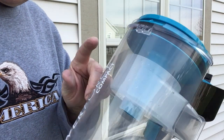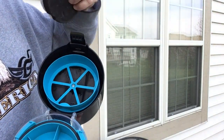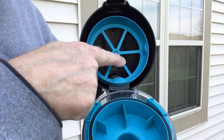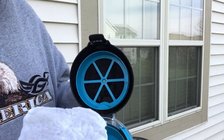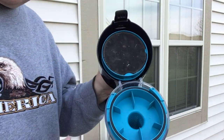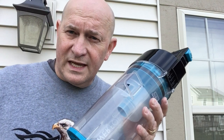Mine's still a little wet — you can see some watermarks because I did clean it all out. When you clean out the filter again, the filter has a little notch on it and you'll see two notches to accommodate it — one big one and one smaller one — so you can make sure it's going in the right way, meaning the paper side is toward the suction going toward the motor. That way we make sure there's no dirt and dust getting drawn into your system. Close that up. Take a damp cloth, wipe off the rest of the unit, and then snap the canister back into place.